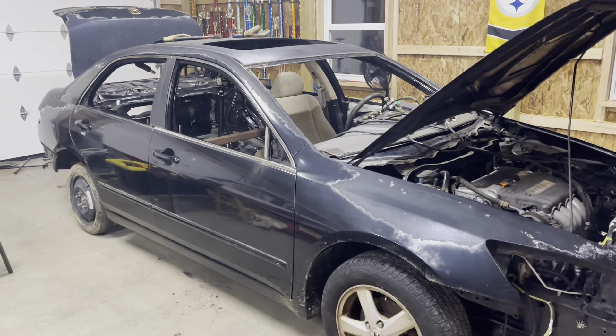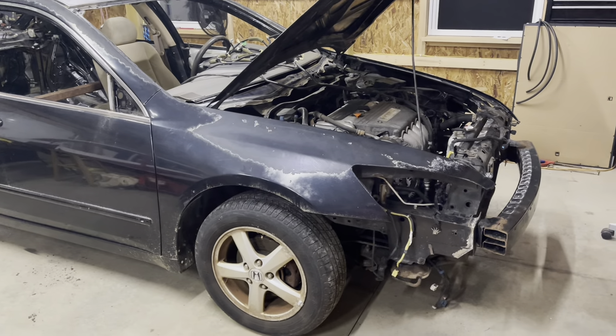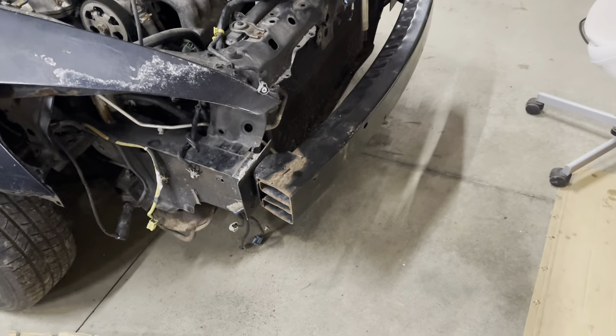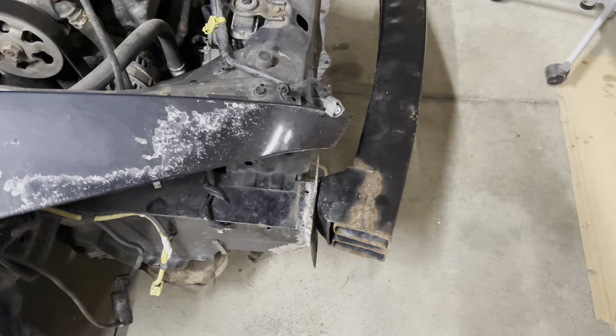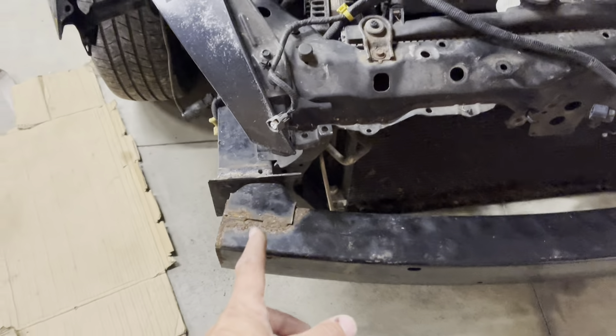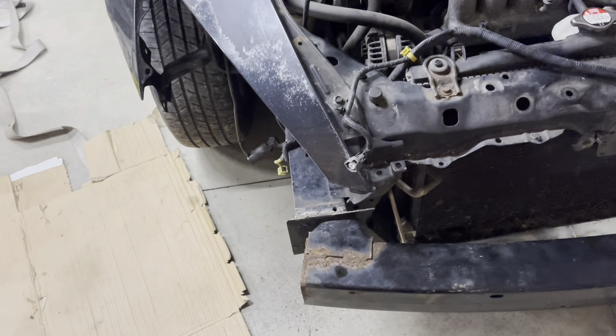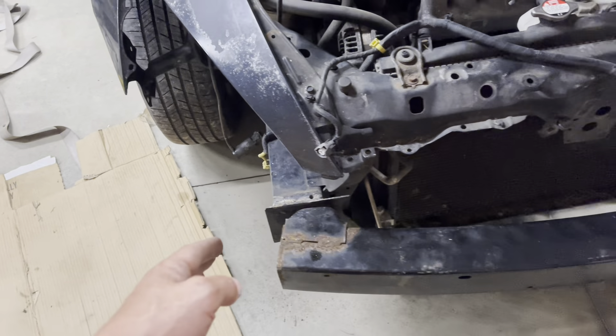Final look — it is late in the night, actually into the morning. We got a pretty good weld with our caravan bumper. We cut the top and bottom off with the sawzall so it'd be more flat, sticking up over the frame rail just a little bit — just a little inside of where you'd like — but with the weld on the top and outside that we got, it should be good.